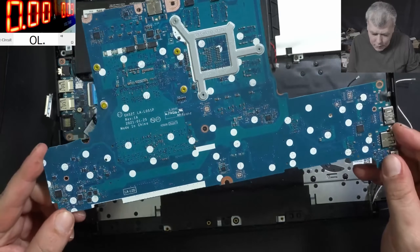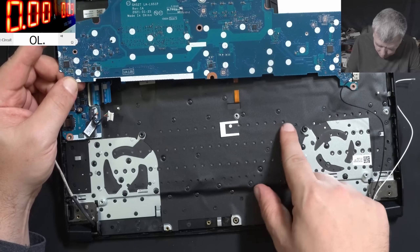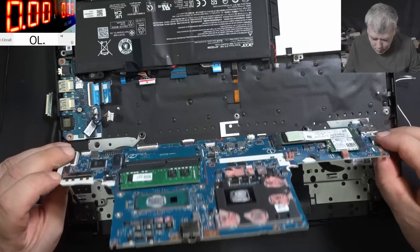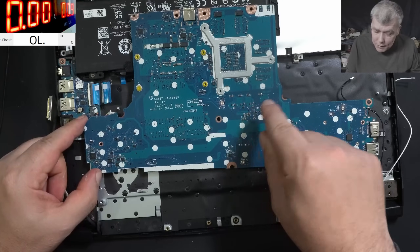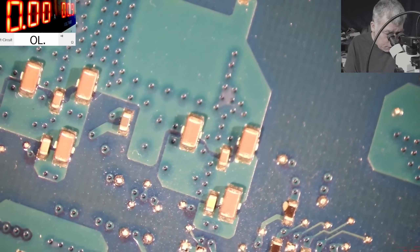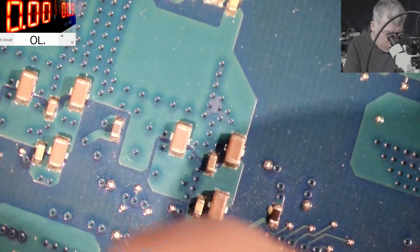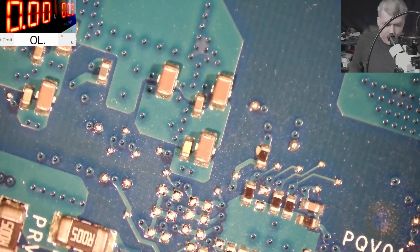The motherboard is out. You remember the video where the customer smashed the keyboard and shorted the capacitor? This one looks fine though - it must be one of those capacitors. Based on what I've seen on the thermal camera, there must be a burnt capacitor here. Let's go under the microscope and check closer - maybe we can spot it. All capacitors are looking fine visually. I can't spot the fault - can you? It must be one of those three. We don't need the thermal camera - I will come with some alcohol and the power supply to find it.